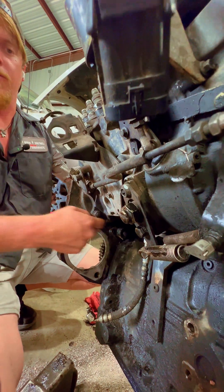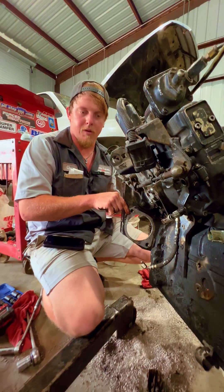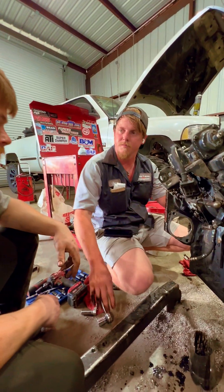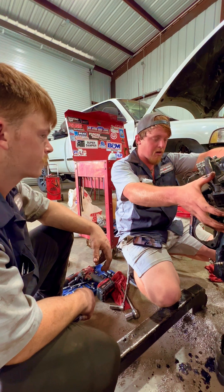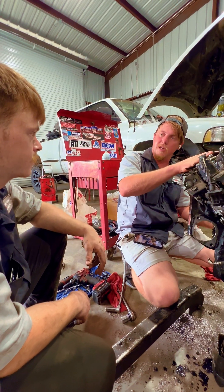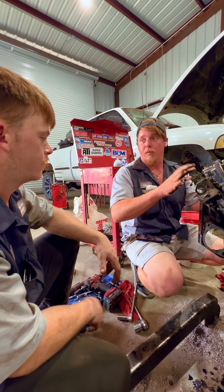Remove these two bolts — these 4-15s — use a steering wheel puller to pop the gear off the cam of the pump shaft. And it's done — pump's timed. You'll remove it, and when you go back together it's already set for timing. You put the engine at TDC, reinstall the pump, and like I said, then we can advance it and go from there.